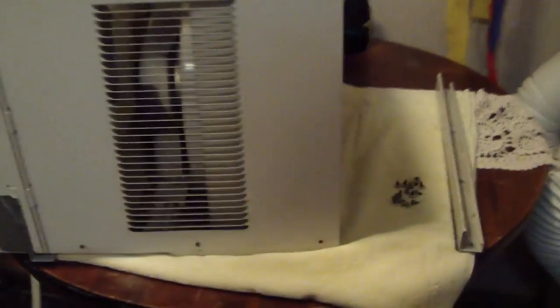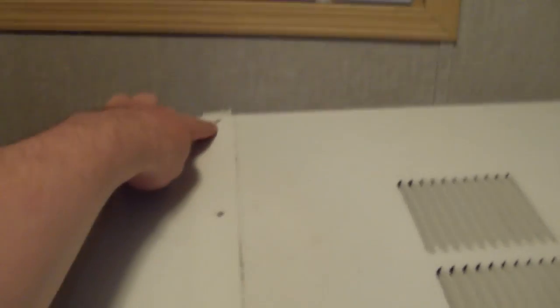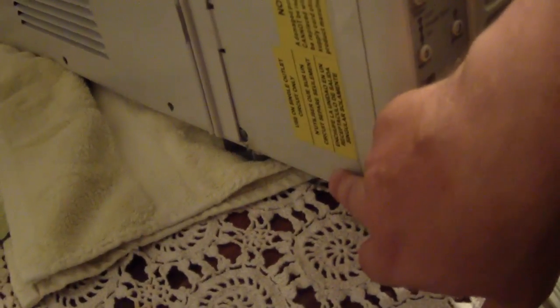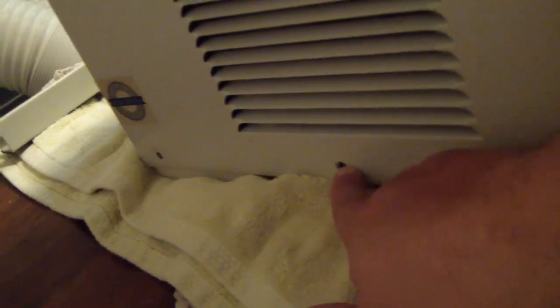To service your air conditioner motor, first remove screws here, here, here, here. On the top you'll have one here, here, here — that's where the brackets are. This is after you take off the side curtains. On the back, at least initially, you only need to take the ones off at the top on the two corners. Coming around to the left side, there's one down here, one up here, and back here.